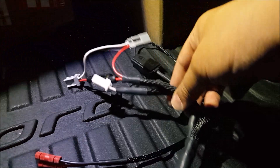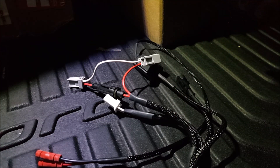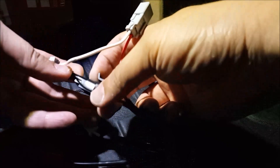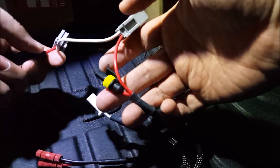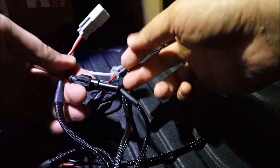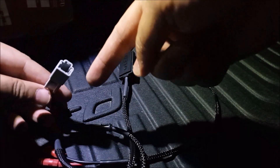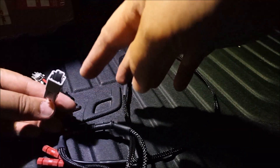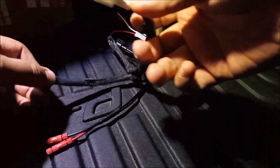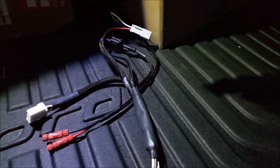I've also made this so it can be used for the 2017 hybrid tail lights, which are all LED for both brake and tail light. All you need to do is on this side, which has your halogen adapter, lift this up and take this out. There'll be an extra harness right here — connect this in here — and then take your stock halogen brake light and stick it in here, then stick the rest of it into the 2017 tail light and it will also work.